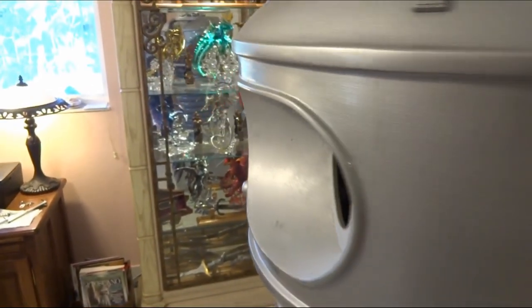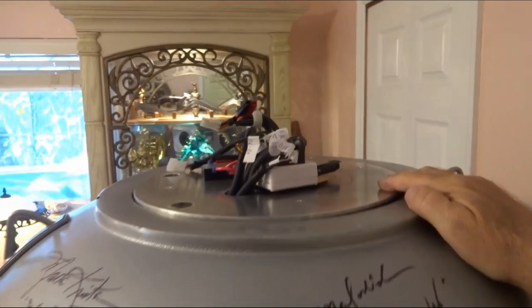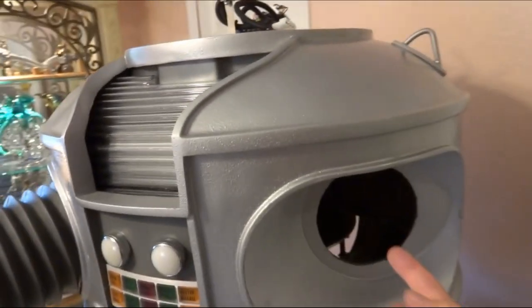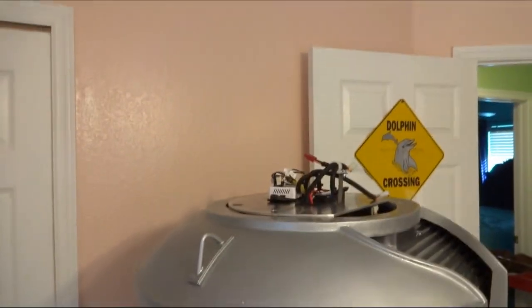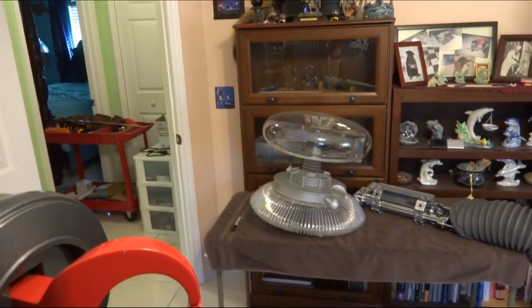Another way to do it is to reach up through the rear vent all the way up to the top here — it's kind of a reach, and I've got long arms and it's a total stretch for me, so if you've got short arms that's not going to work. I'm going to just set this head section on there and reach in through this hole right here to bolt it down. You can't reach the other side so both arms have got to be off to do it that way. This is a two-man job getting the head section up here, and again you've got to look up and make sure nothing is going to clip it — you don't want to bust or scratch that bubble.